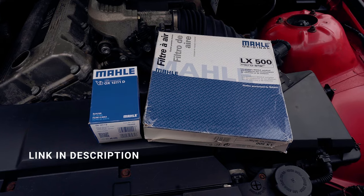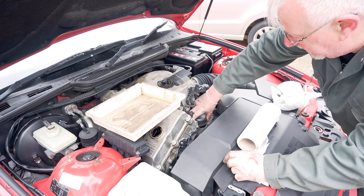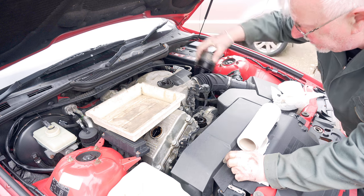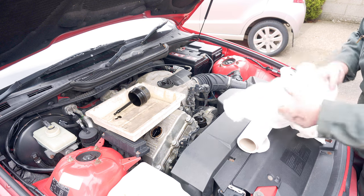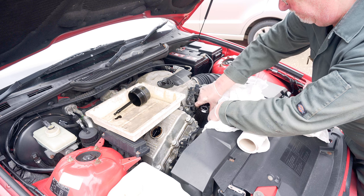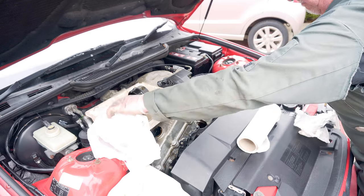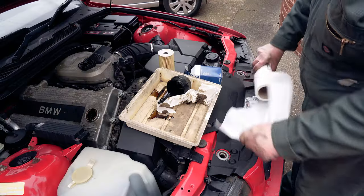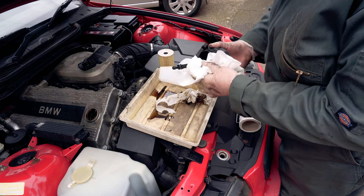I'd already bought an oil and air filter and I like to try and buy German brands for German cars. The oil filter itself unscrews quite easily, although sometimes these caps can get stuck. Always have somewhere to put the oily bits — I use a plastic bag to put the filter straight into. I will have a look at it afterwards to make sure there's no bits of engine debris in it, but I don't want the oil all over the interior of the engine bay. It's a little bit mucky in there but nothing you wouldn't expect after 7,000 miles, so a good wipe out. Make sure your hands get nice and mucky and then put the new filter in.